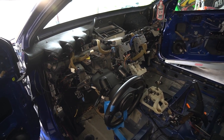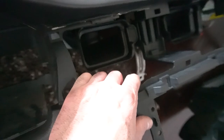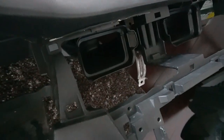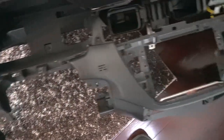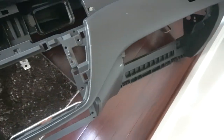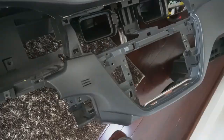If not, at least we learned how to get the dash out. This was the bracket that was giving me all the problems — all the rest of the dash is pretty straightforward, the bolts are visible. You do have to remove the ECU bracket to get to the two airbag bolts that are up inside the dash; those are the two hardest ones to get to, but I found some information on that.